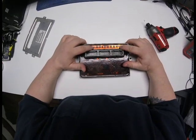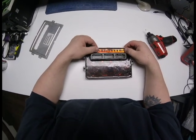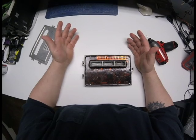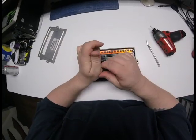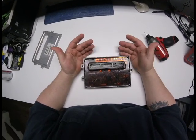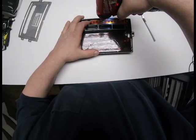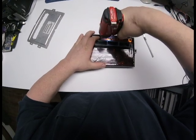Next, what we're going to do: these screws right here — they go down. This is a metal tab, and what that tab does is act as another heat sink. It goes down and touches on the alternator driver and the coil driver, just another attempt at keeping this thing cool so it doesn't damage these components and they don't overheat and fail. These screws go down and hold it, and the heat is actually supposed to transfer through the screws to the case. So, the next thing we need to do is remove these three screws — just push right through the gel on these and let them pull out.